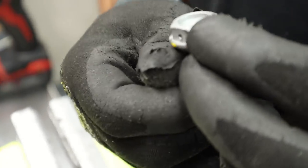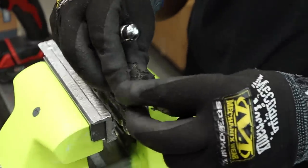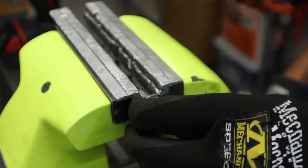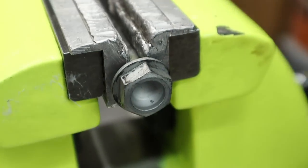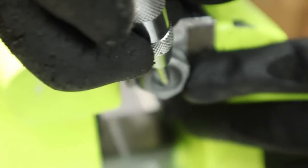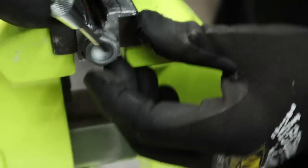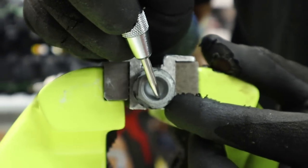Well, that's good. So anyways, if this happens, you take your automatic center punch like this. This doesn't work every time, but I'm just going to show you a little trick, in cases like drilling out banjo bolts and things like that. I've had that happen many times. You guys could see it started to come through and catch, and that's why it caught and snapped. I just feel the edge of it. Yeah, that's in there still. That's the bit.